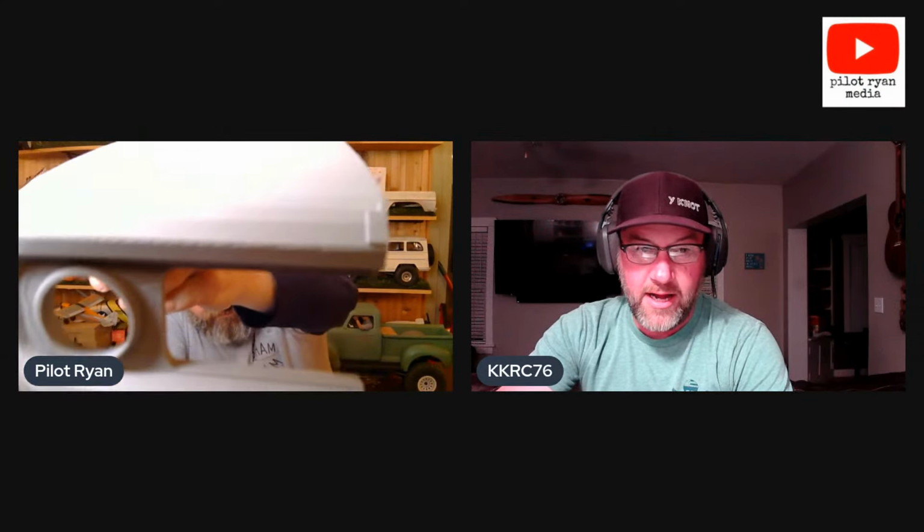I'm not living with that, bro. Which means I'm going to be sanding my face off. Just sand those lightly with a fairly aggressive grit. Yeah, no, I had the same thing. But I sanded with a fairly aggressive grit paper, like 120, whatever, and just sanded on those lines to get rid of the majority of it, and then just put that Bondo paste on there, and it'll be virtually non-existent.